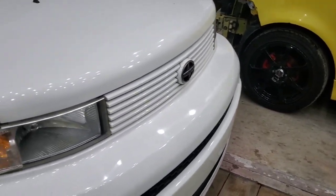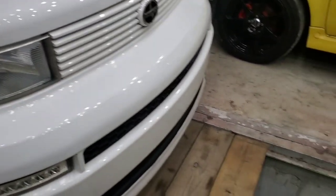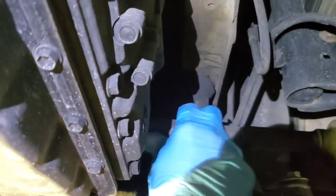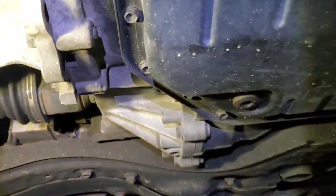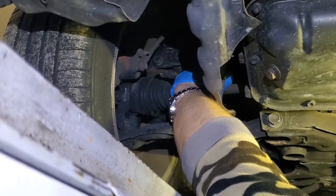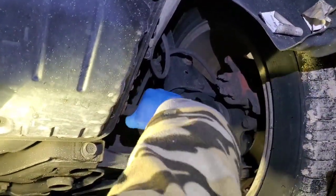Let's get underneath the vehicle and check. We're shaking the driver's side — oh yeah, it's mostly on the inside. It's clicking, clicking again — it's broken. We tried the other side and there's not much movement at all. Pretty much it's the driver's side, and that's really bad.